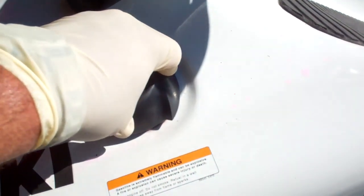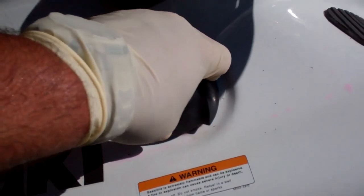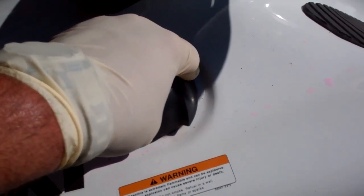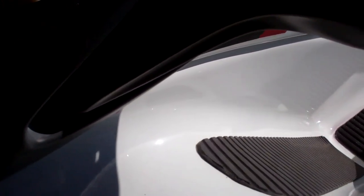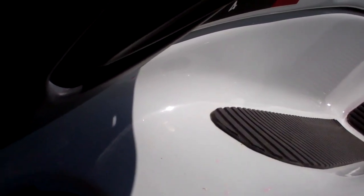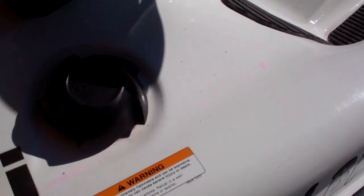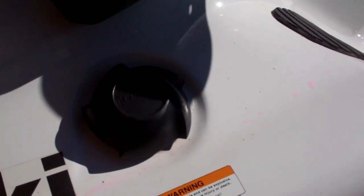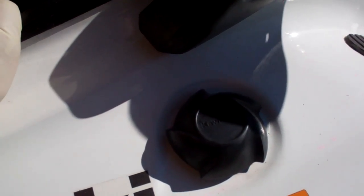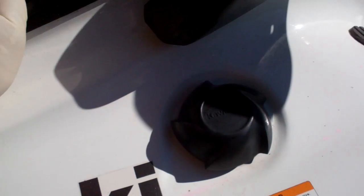The next thing I did was go ahead and completely drain the fuel tank. I drained it right through the fill — just put a hose in there, tilt the whole thing forwards, get a good siphon going, and completely empty it. Once I got it emptied, I went ahead and got some fresh gas, put my stabilizer in it, put a couple gallons in it, and that's so you can move on to the next things you need to do and actually get the stabilizer through your fuel system. So once you have that done, you basically move on to the oil change, which I'll be covering next, and then I'm going to move on to the cooling system and show you what I do there. And we're going to end up fogging the engine, spraying everything down, and be pretty much done with it for the season.